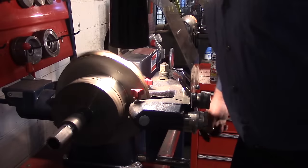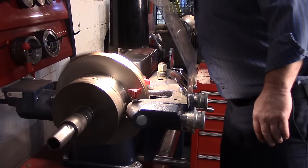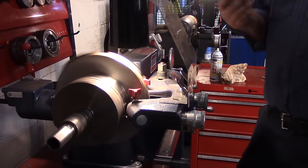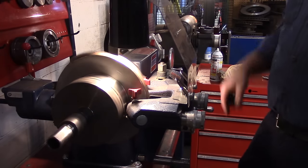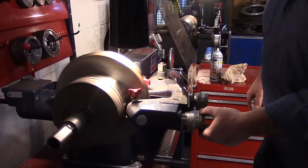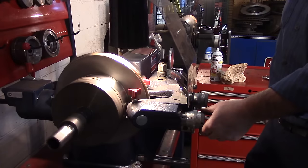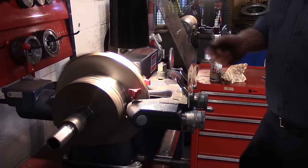Now I'll bring the cutter all the way in, past the surface area where the brake pads ride. The basic rule of thumb is you need to take at least two thousandths of an inch per side off — taking less can heat up and damage the bits prematurely. I'm going to go with three thousandths per side, taking a total of six thousandths off. We had about 65 thousandths to play with, so we're in real good shape. I'm setting three thousandths on each side.